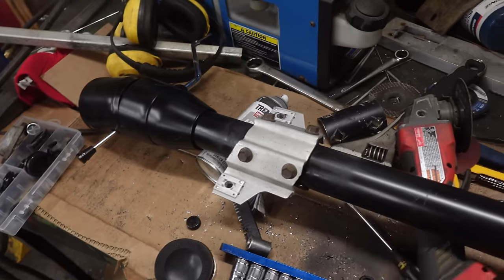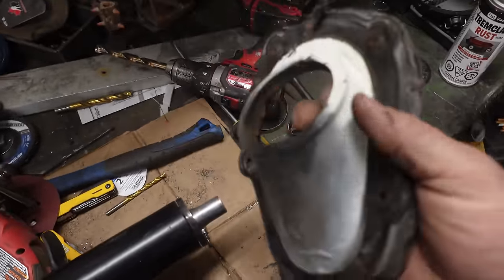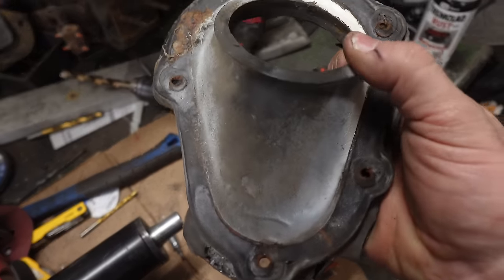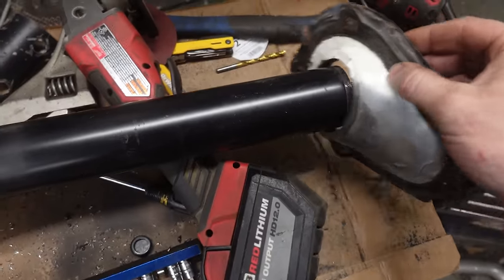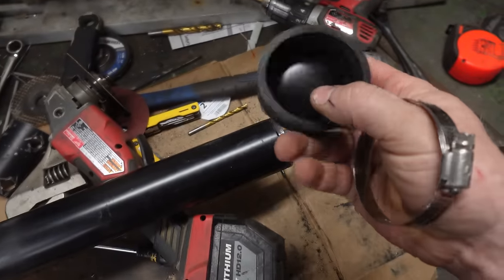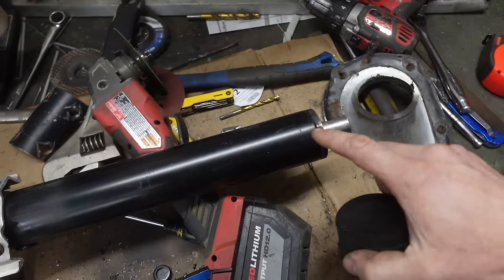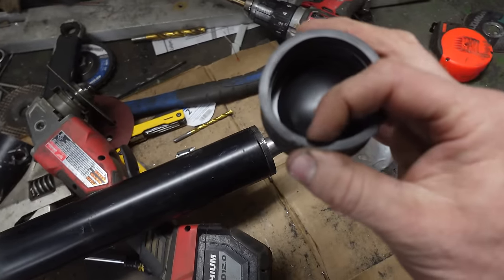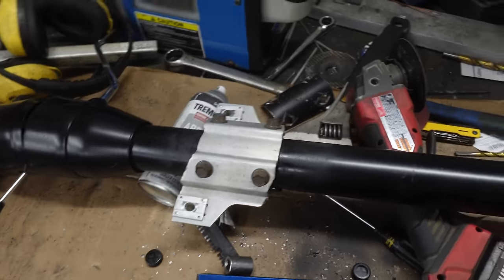Because we got the mount on, now this kind of supports the bottom of it, and it's a seal at the same time, so you do want that nice and tight because otherwise too much engine noise comes in. And it's still pliable, so there's nothing wrong with this other than it's a different size and it slops around a bit too much. So I just went to town, got an ABS cap, 2-inch, and that should cover that up. Comes with a free hose clamp. You take that, throw that away, cut out the center so that it's tight around here. I think it should be the difference all the way around, and then that will seal that up, and then we can mount it.